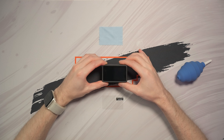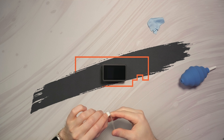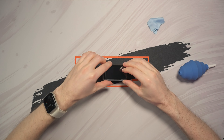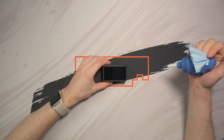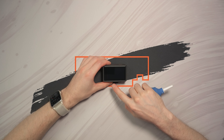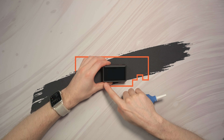Now we are ready to move on the back side. Use the same cloth and wipe the screen — it looks pretty clean. But be aware, on the bigger screen you have more chances to catch some dust under the protector, so be careful. One very good trick is to turn around and blow the screen protector because after you have put it on the desk it for sure has some dust particles on it. Align it and it should go very nice. I caught some dust particles on the side here but it should not affect the screen quality since it is over the black part of the screen.